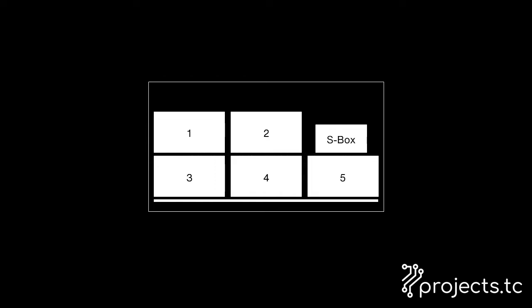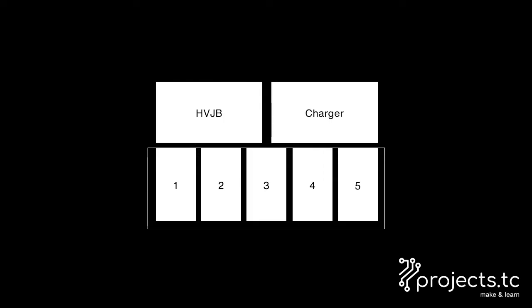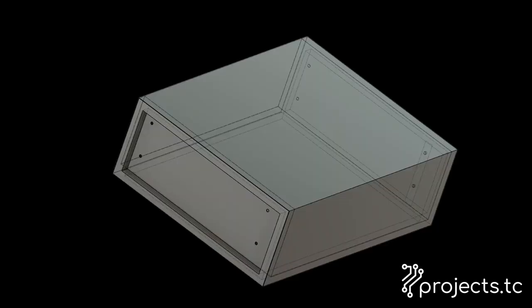Quick recap from the plan video. The aim is to make some more space in the engine bay, and the way I'm going to do that is to change the layout of my battery box. Right now I've got five modules stacked three across and two high. I'm going to shorten the battery box by rotating each module through 90 degrees and putting them side by side, and moving the S-Box — the high voltage junction box if you like — out onto the top. This creates some space to go side by side with the charger, which means I've got space either side of the inverter for various ancillaries. This is all going to go into a frame that I've knocked up in CAD, of 20 by 20 steel, and one millimetre sheet steel wrapping around the batteries keeping it all watertight. Some might say this is over-engineered and unnecessarily heavy, but these are great big heavy cells and my engineering skills aren't that good, so better to be safe than sorry. It's certainly going to be lighter, smaller and neater than what I've got right now — an incremental improvement, I hope.